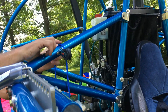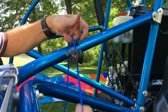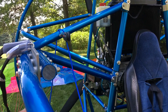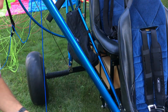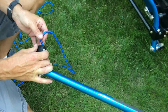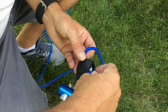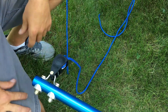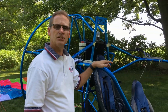Be careful not to drag the steering line across the powder coat — this nylon steering line is very abrasive and it'll burn your powder coat. Make sure you stay inside your safety cable, under your center of gravity bar, basically through the opening here. Then you come down here through your line trimmer. You start by going in the back side of the line trimmer with your thumb, just kind of click it around — it comes out this way. Tuck it in so it comes out the top, and then just pull it through. In a minute we'll lace up the other side, and then I'll show you how to preset the chute for pretty much any chute you're going to put on your plane.